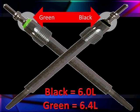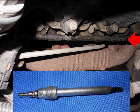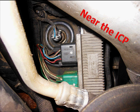We have two different versions — actually three. There's a green and a black, but the black is for the 6.0, and we have two versions of the 6.0. You must order by the VIN number and the revision number. Here's the actual glow plug we removed so we can look at it. There's some difficulty removing some of these — use an engine solvent around the top and let it sit for a few hours if you have trouble getting it loose. Don't break it off in the cylinder.